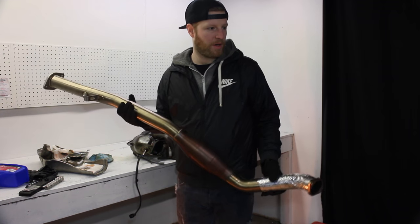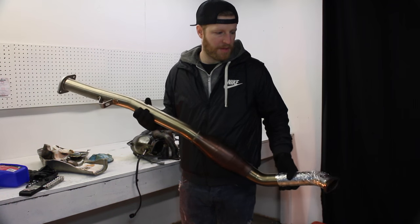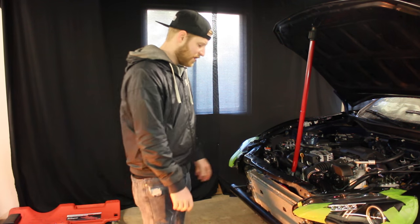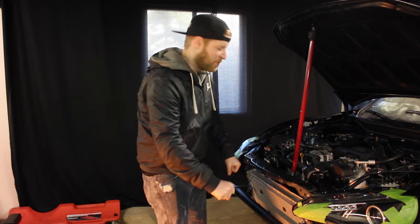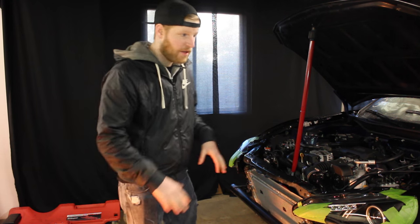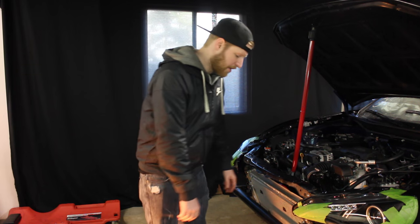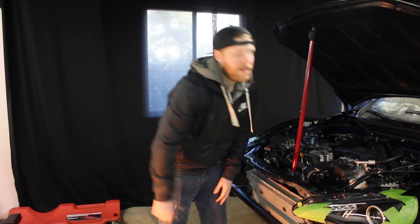I'm going to jack up the car, put it on four jack stands - every corner raised up nice and high so I can get under there with the creeper. Well, I got the car all jacked up on four different jack stands and did the safety test - grab onto the front crash bar and wiggle it back and forth as hard as you can to make sure things settle in and it's not going to fall off any jacks while you're under there wrenching on it. It actually did pop and move a little bit to settle in, but it's good now.